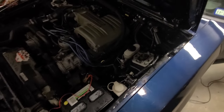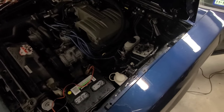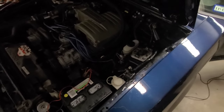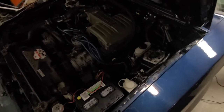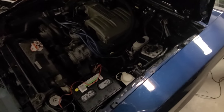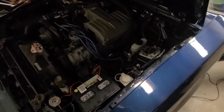So I pulled apart the connectors here. They go to the headlight harness, and man, that was full of water. So every time I would hit my blinker, that would cross over and make a circuit completed for the entire blinker assemblies. So it wasn't sending one signal to one side. It was sending one signal to the entire harness. Obviously, that's bad, right? I mean, it doesn't hurt anything except my ego, pride, and time frame. However, after addressing that issue, I just figured you guys would get a kick out of something so stupid.